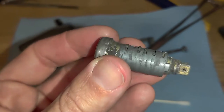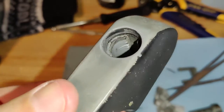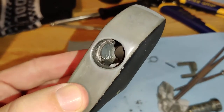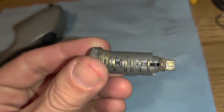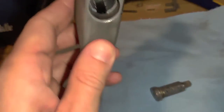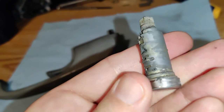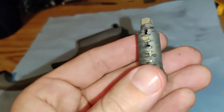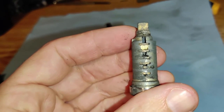This is really nasty. Look at all this crap I got out of here with a little screwdriver. A toothbrush would be good, but some forceps and a piece of cloth would do a pretty good job. I'm going to go over it one more time — I think this is a security issue, because those little plates are supposed to spring out and they're not. They slide into grooves and prevent the cylinder from turning, but the lock is so gunked up they're not sticking out at all. You could probably just stick a flat head in there and open the lock.